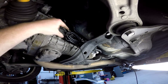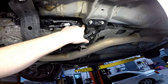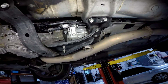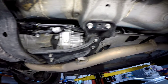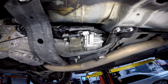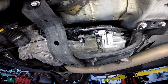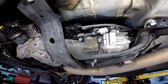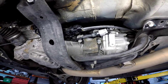For guys who prefer a cleaner race car setup, we include all the zip ties you need. Simply secure the harness onto the factory harness — use as many zip ties as needed. Make sure the wiring that runs back here is secured in the factory brackets, and that the wire is not coming into any contact with the shifter linkage or the driveshaft. That's really how easy the install is — it takes about 45 seconds on a lift, or a minute or so if you're working on your back.